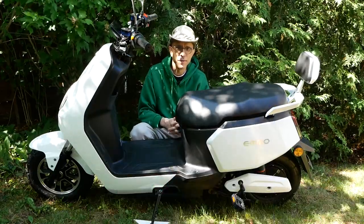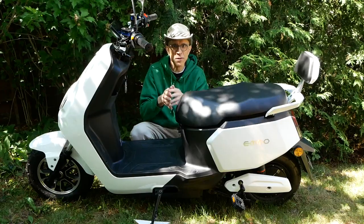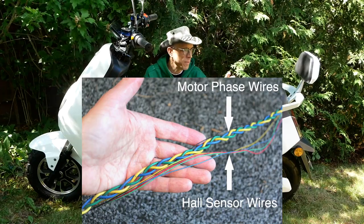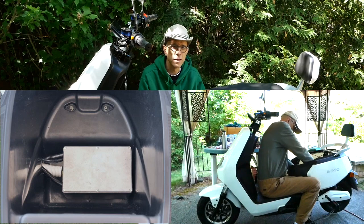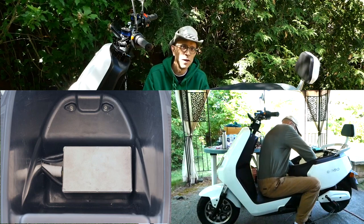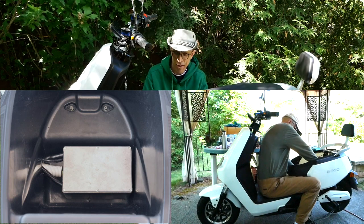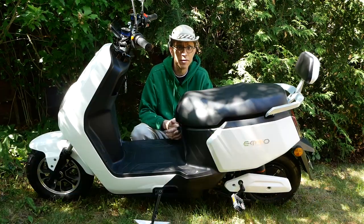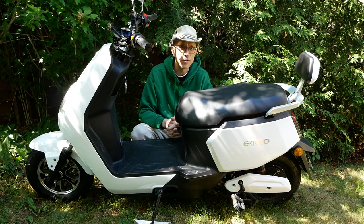To solve that, from experience mitigating other issues, the motor phase lines — in order to help self-shield the magnetic fields — I actually braided those wires, and I moved the motor controller from up here down into the bottom of the storage cabinet, so that involved rerouting some wires and doing some wire splicing. The point is, this is something that the average person not involved in electronics or familiar with soldering skills can't do, but it is something the manufacturer can do.